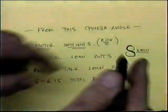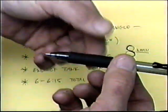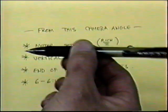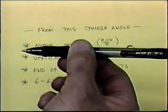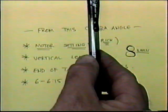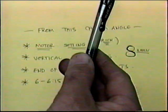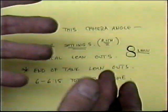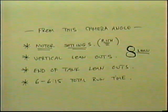Now, the 91 has about a half a needle valve turn. I can go basically from 3 o'clock to 9 o'clock. So what I do is I find my too lean setting, where it starts to lose RPM, back out a quarter of a turn, and I know I'm going to be real close. I know I'm going to be a click in or a click out. And that works every time under every condition. There's never a time you have to put up with a lean or a rich run.